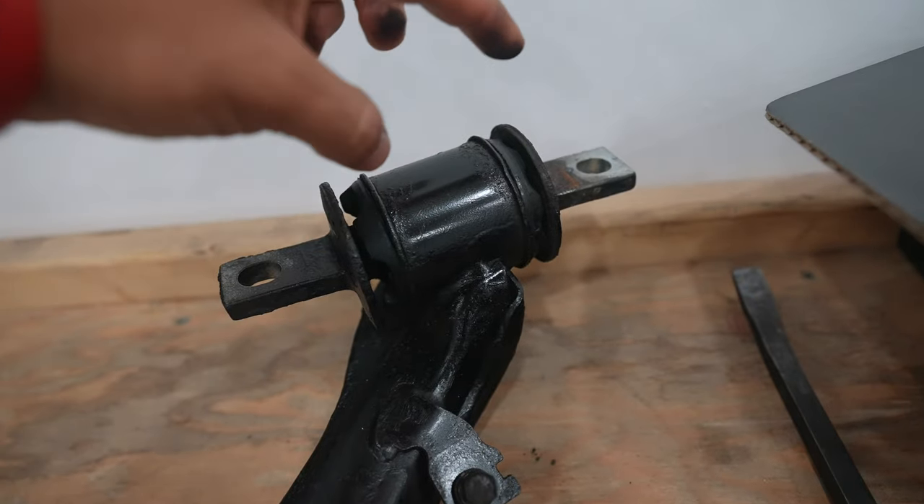The polyurethane itself does fit inside the 9th gen, but I'm genuinely surprised there's no kit for the 9th gen Civic that replaces every bushing. This is the best solution I've found for 9th gen cars — specifically a 2015 Honda Civic. The 2012 through 2015 sedans and coupes run the same suspension. The coilovers differ between SI and non-SI for 2012-2013, and the 2014-2015 SI is different due to the front knuckle, but that doesn't affect what we're changing today.